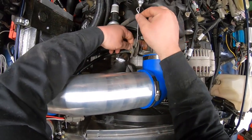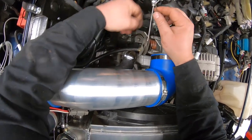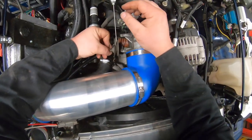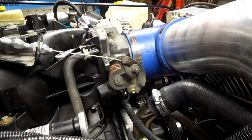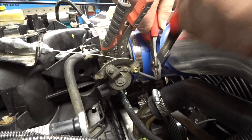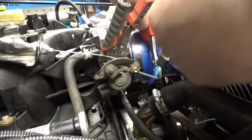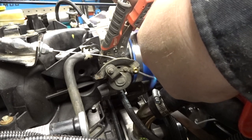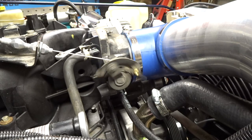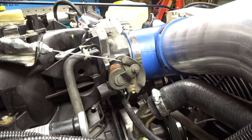I'm just giving it light tugs to see how much more pedal I can get, then pulling down on the wire and giving it a couple of gentle pulls so all the slack is pulled out, and then locking it down. Now you can see the throttle cable is a bit tighter. I put a small piece of heat shrink on the cable, heated it down to shrink it, then used a pair of pliers to cut it — that way the wire won't fray and it's not interfering with anything, so the throttle can move freely.